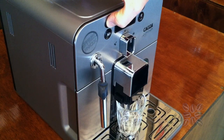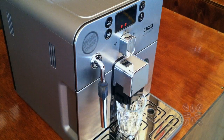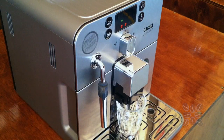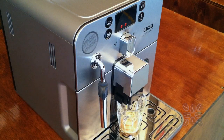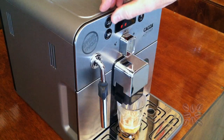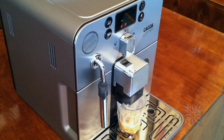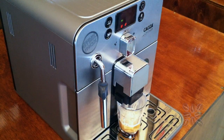It takes a couple of seconds before anything happens — you'll hear the grinder going, and because the little cup icon is flashing on the front, that means it's programming how much coffee goes into the cup. Once it's ground the coffee, tamped it, and it starts flowing out, we stop the button when there's enough in the cup. Very simple process — you can program two different coffee sizes. Just watch the coffee going into the cup and when there's enough for the shot, stop it, and that's it programmed. Every time you push that button you'll get that amount of coffee.